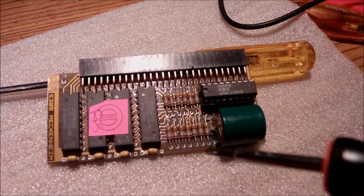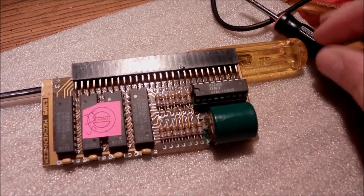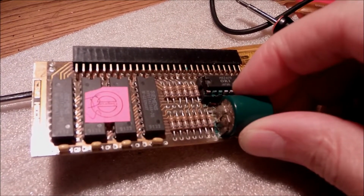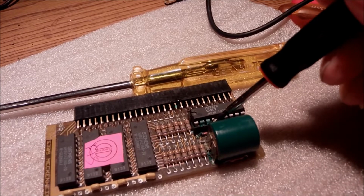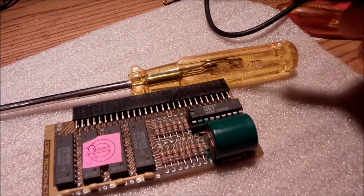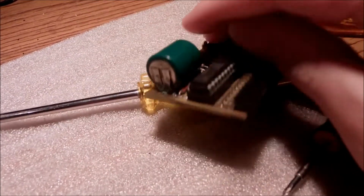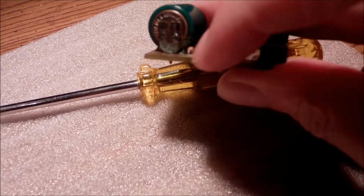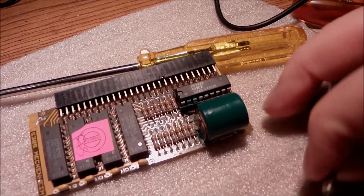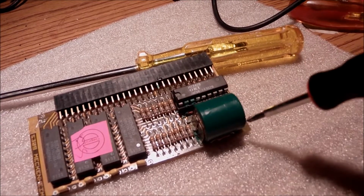Now back to the real-time clock module. I'm going to put the neutralizer, the domestic neutralizer, could be vinegar, could be lemon, to remove the rust and neutralize the acid from the battery, but also the mold from the IC pins, and see if we can make it work later, because now I don't have a battery to replace this one for now. But I'm gonna put it on the Amiga for the initial test, and see if it's gonna be working at all.